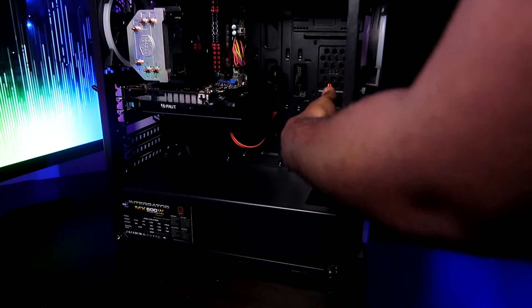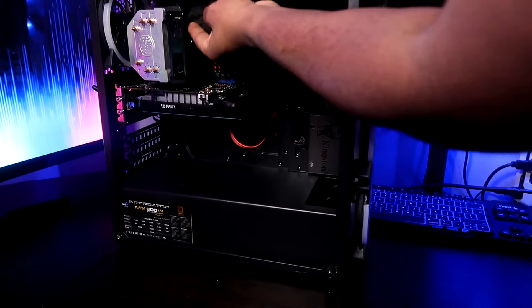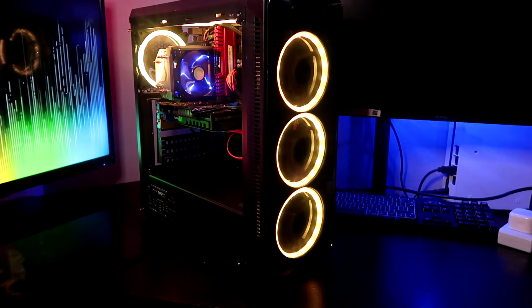I would say if you have your gaming PC on a desk, that is a great place to keep it. But if you have your gaming PC on the floor and it is a hardwood floor, then you just have to clean your dust guard more often. This is something you really should note: if your gaming PC is on carpet and you have a lot of carpet fibers continuously being blown into your dust guard, your dust guard is not going to be able to protect your power supply. I've come across a lot of PCs needing repairs, and dust from carpet fibers is usually a common problem. So please, make sure you put your PC on a solid surface and try to protect it from dust as much as possible.